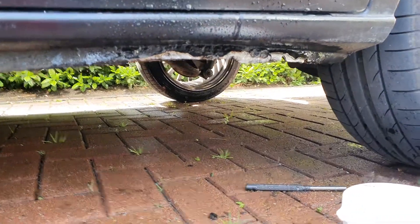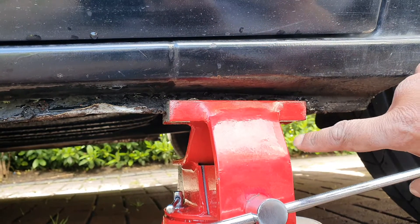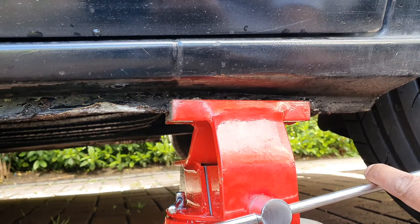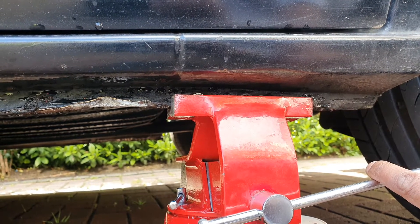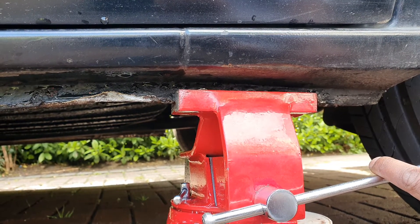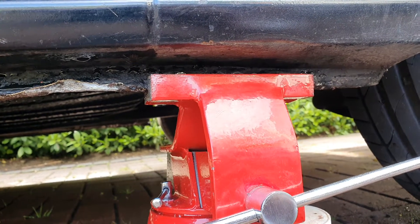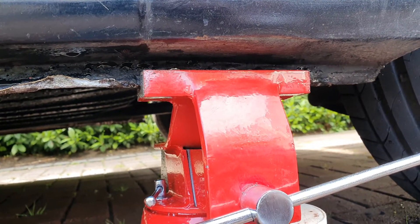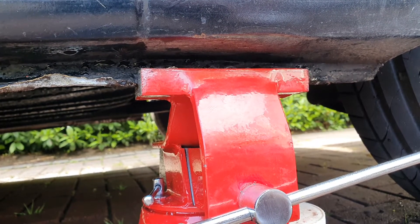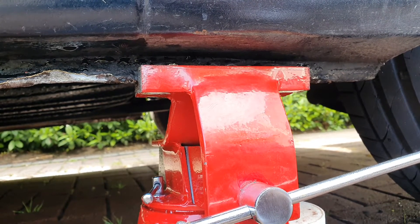You can see the metal straightening up now. I'm applying this vise onto the sill, tightening it as much as I can and then leaving it a minute or two before tightening again. That allows the metal to compress nice and slowly so it doesn't harden from rapid clamping — it just goes in there slowly, compresses, and forms the shape you want.